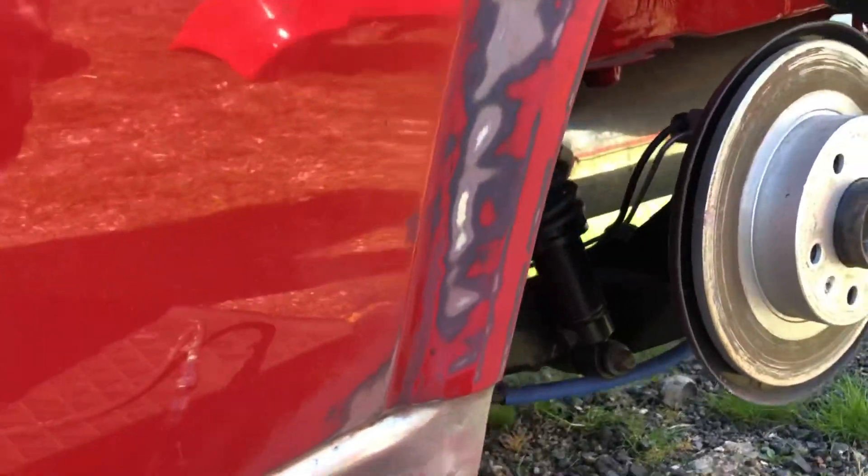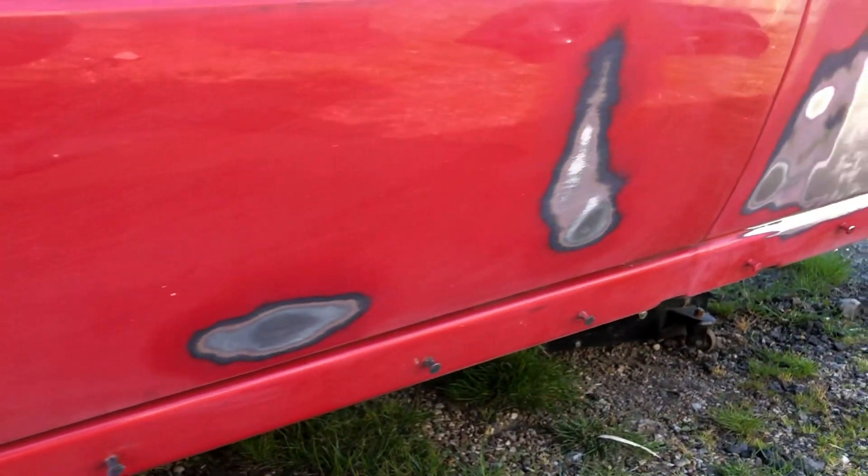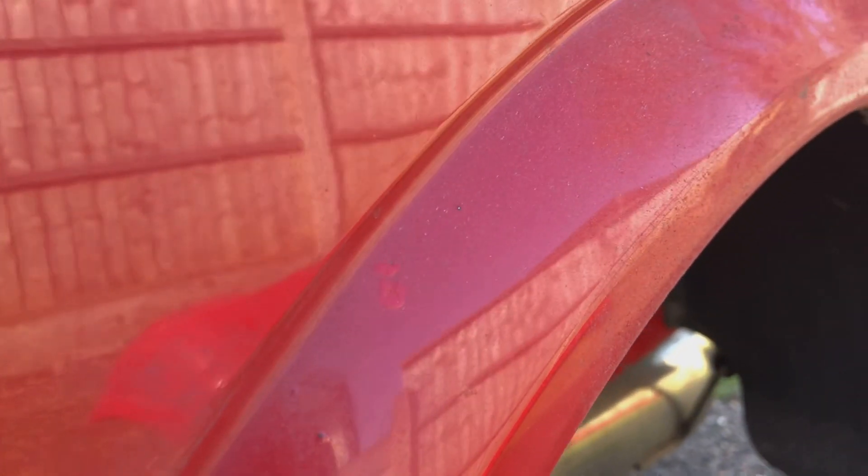I started sanding down where the side skirt had been rubbing on the seal — you can see a little bit of surface rust — and then I noticed there were a lot of stone chips in this rear quarter. Stone chips go back to bare metal, so I stripped it all the way down. As you can see, where the stone chips were there was a little bit of surface rust, so I'm very glad I've gone back to bare metal. I didn't want any little bubbles coming back through the paint in the future. There are also a couple of little dings on the door that I pushed out from behind and I'm going to put a skim of filler on them.